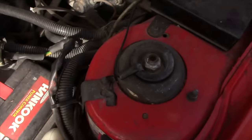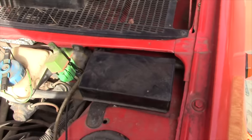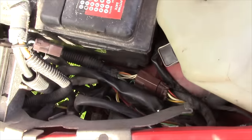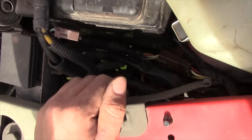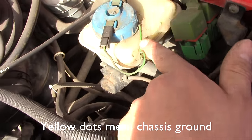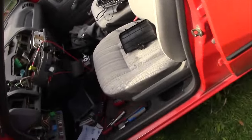Going to the engine compartment, I noticed there's a green wire coming to this relay box, which is a bit weird since these are for the headlights. I took that apart, removed the relay, and there wasn't a cable running there. I started digging around in front, where I know there's been some wiring issues, but I can't really find the proper green wire and disconnecting the cables here does nothing. Then I noticed there's a green wire coming to the brake reservoir — this one has yellow dots, meaning it's a different cable, but then also this one is a plain green cable, and indeed disconnecting that makes the short go away.